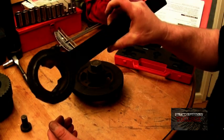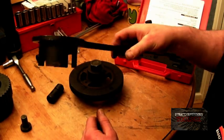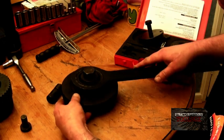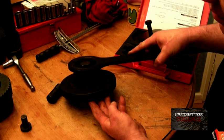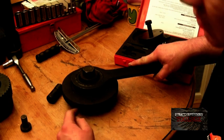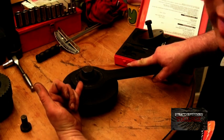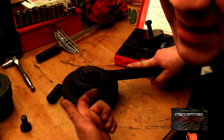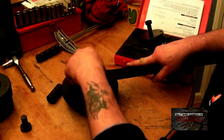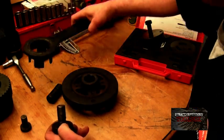What I have here is FR Churchill number FR 101 — that's for holding this while it's on the engine so you can crack the dog nut off with an air gun or a socket and bar. Once that is off, you can then put a puller on this.